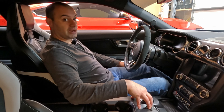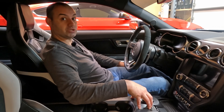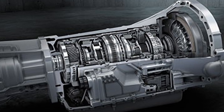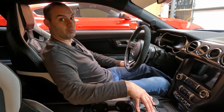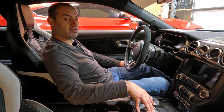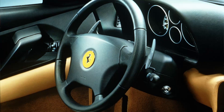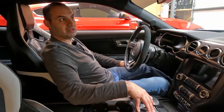A lot of people simply dismiss this as an automatic transmission, which I think is pretty short-sighted. When most people think of an automatic, they think of something with a torque converter and planetary gears — like the 10R80 used in everything from the Mustang GT to the Ford F-150. That's a good general-purpose automatic but not the best for performance. This is also very different from the e-gear and F1 transmissions in late-90s and early-2000s Ferraris and Lamborghinis — those were essentially manuals with a hydraulic actuator bolted on, never really designed to be automatic from the start.